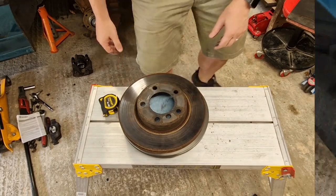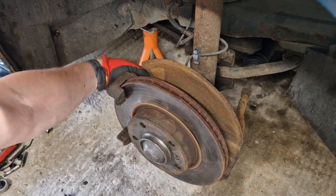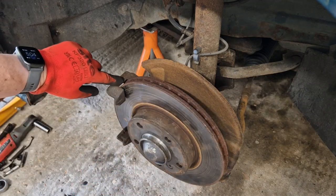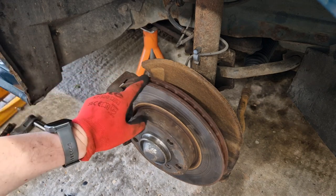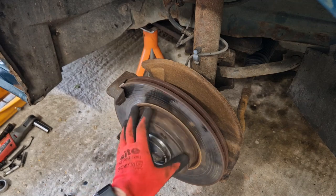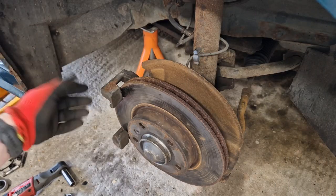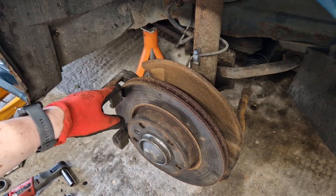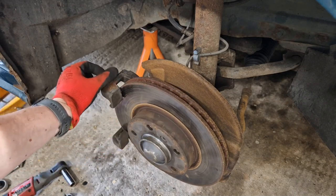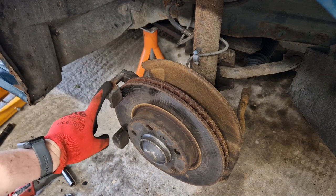Let's get them on the car. Firstly, this is the original disc and the original caliper carrier fitted up — as you can see the disc spins fine but there's only a very tiny gap. You cannot get 300mm discs in using these existing caliper carriers; there just isn't the room. With the new but second-hand caliper carrier, there's a much more significant gap, which is how we accommodate a bigger disc. This carrier sits that little bit further out and stands the calipers slightly further out so we can get a bigger disc on.